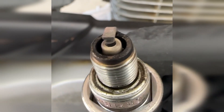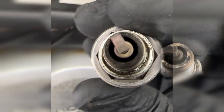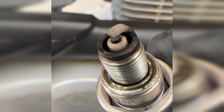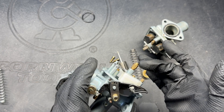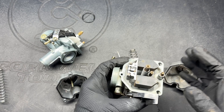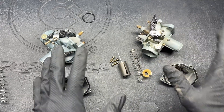Just like the first carb, when I pulled this one in and took the spark plug out, it's a lot lighter with the aftermarket carb. There are a few reasons for this: the main jet on the aftermarket one was a little bit smaller, contributing to it at wide open, and the needle was fatter — so it is a leaner needle. Basically throughout the range this should be a slightly leaner carb. After the initial runs with both carbs, I took all the internals out of each carb and swapped them with each other, then did two more runs with each combination just to get an idea of what exactly was influencing different aspects of running.